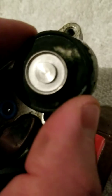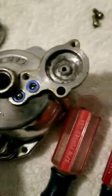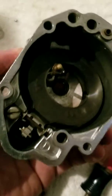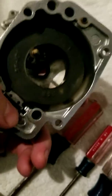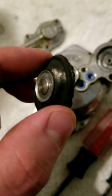In any case, great discovery. Glad that YouTube exists and there are good mechanics out there who were able to help correct this. I had the fortitude to pull it apart on my own and see what's going on. It also gives me the opportunity to clean some of this sludge out. It had just been done and it's in pretty clean condition overall — the float moves pretty well, doesn't stick, it's pretty clean in there. But regardless, it was obviously assembled incorrectly. We're going to put those balls back in there along with the spring, get a brand new diaphragm, and get it assembled correctly.